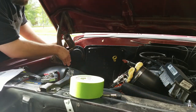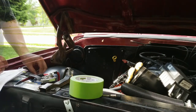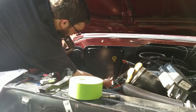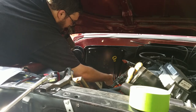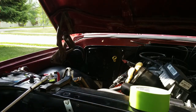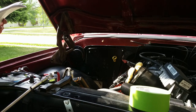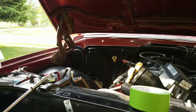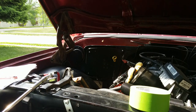There we go. There's the top two bolts. Roughly installed. I went ahead and threw nuts on the back sides of those just so I don't lose everything. Now I'm supposed to drill an 11/16 hole. You can choose to use a pre-existing hole as long as it'll be lower than the drain nipple. And the diagram shows it being that hole right there that you're using as your pre-existing hole. 11/16.